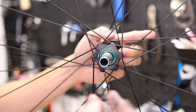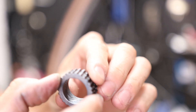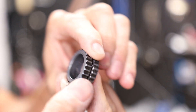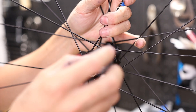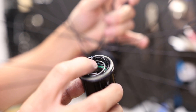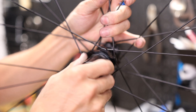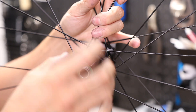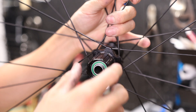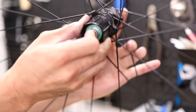To reassemble, slide on the little spacer followed by a lightly greased spring — the larger diameter end faces towards the bearings. For the ratchets, the sides with the ratcheting face need to be facing each other so they engage, with the flat sides on either side. These ratchets are identical, so there's no inner or outer one; both just slide on. Inside the free hub you've got the other spring, again with the larger diameter of the spring contacting the bearing and the smaller diameter contacting the ratchets. The free hub body slides on as one unit — you might have to align the ratchet splines, but just twist it a little as you push and they'll engage. Give the wheel a spin to make sure everything spins freely and smoothly.